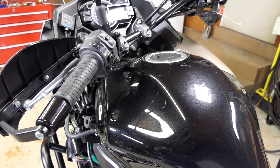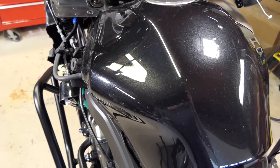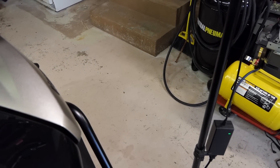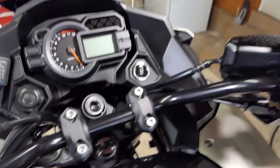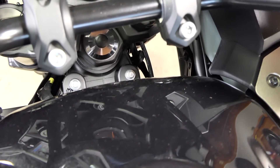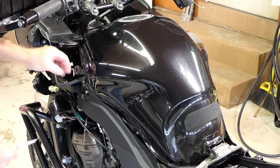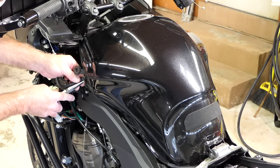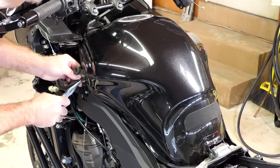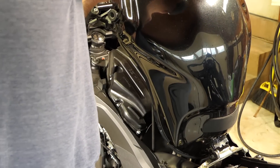The next step is to raise the fuel tank so we can get access underneath. I've got the upper panel off on this side and need to pull the upper panel off the other side — just one screw, same as the left side. Then there are two bolts at the front of the tank to remove. There's also a fuel vent hose on the side of the tank — I pinch the wire retainer together and pull it over the nipple to get the hose off. Then I prop the tank up with a prop rod.